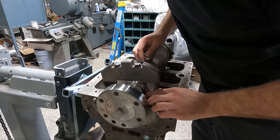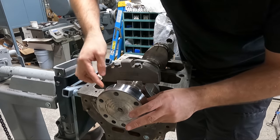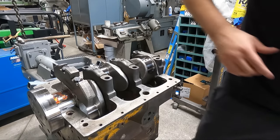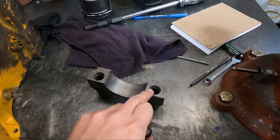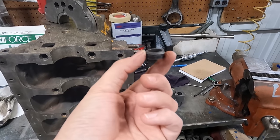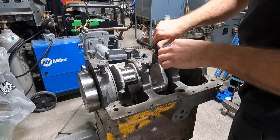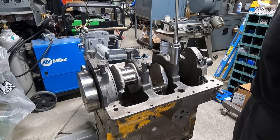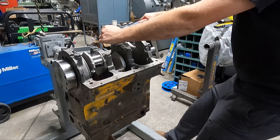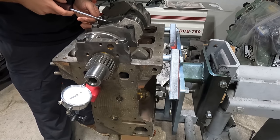We can't forget about installing the thrust washers, and it's always important to make sure that everything is lubed up well with assembly lube as we're going together. As I'm installing the main caps you'll see that I'm making sure they are seated well against the block before tightening them down, to avoid damaging the locating dowels — we had to replace a couple due to the last assembler not being as careful. With all the main caps installed we run them down snug before bumping the crank back and forth to help align the thrust surfaces, and although this block has dowels that align the caps it's something we do out of habit.